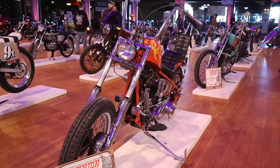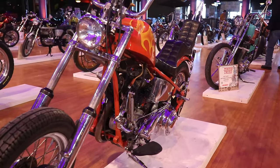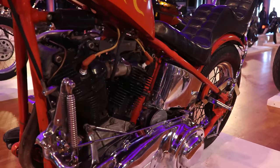I think the top motor mount was very challenging because there wasn't one. And we had to make it work. Also, when they built it, they used a panhead frame for the knucklehead motor, so we had to make about a 3/8 plate for the front motor mount to sit on, so that everything was shimmed right and fit properly.